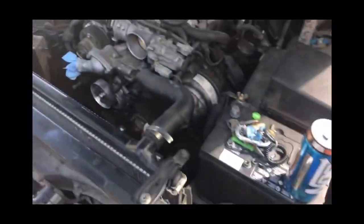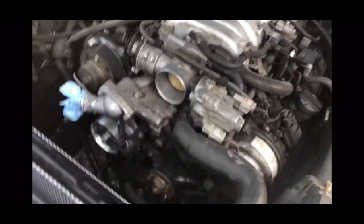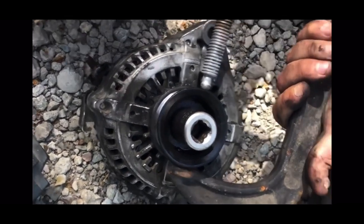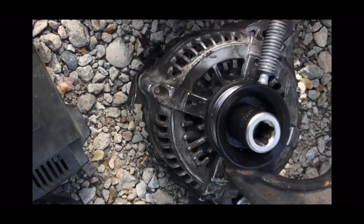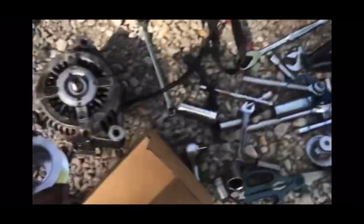This is not a sponsored video — I just bought this to see how it is, which is why I'm making this video. Maybe if you guys don't want to waste money on something that might not fit, or maybe you do want to buy it and it makes a difference — we don't know yet. There's apparently a special tool you need to remove the alternator pulley, but we're going to use a C clamp — tighten it down, have someone hold it while I hit it with an impact. That actually worked great — it just comes right off with a C clamp.